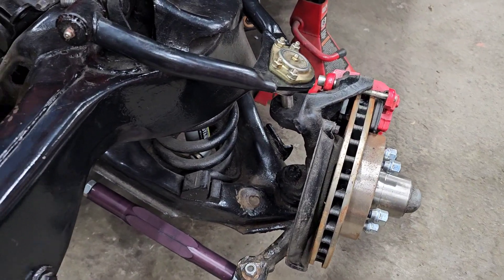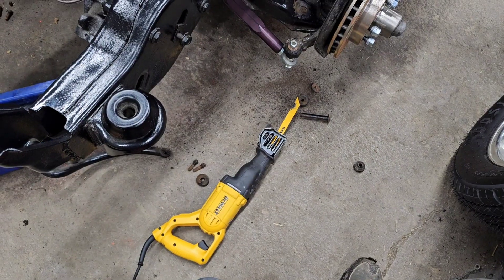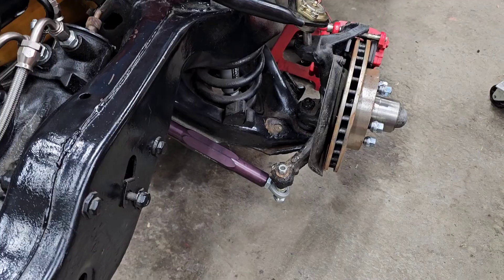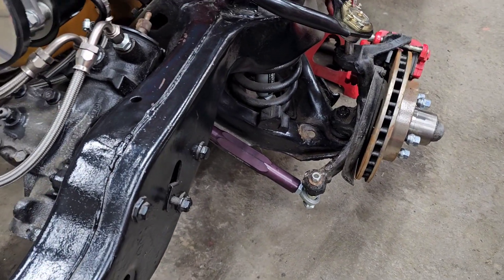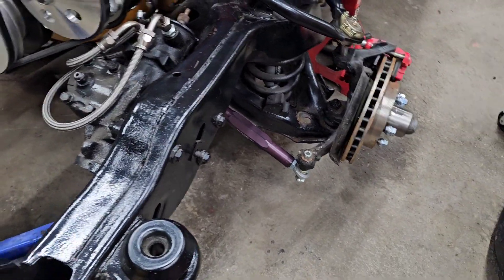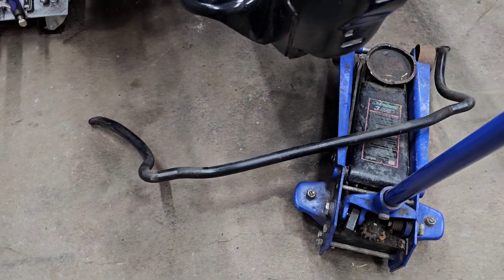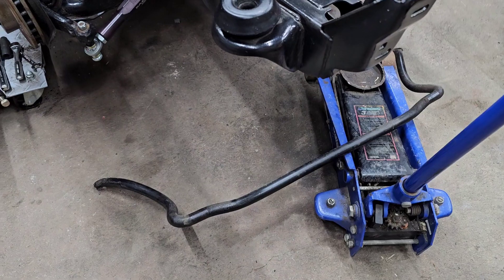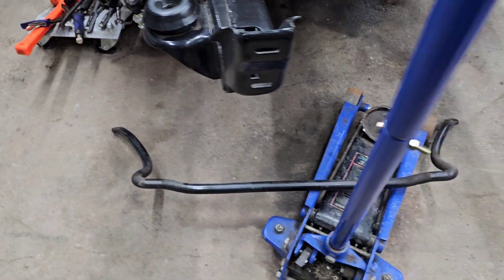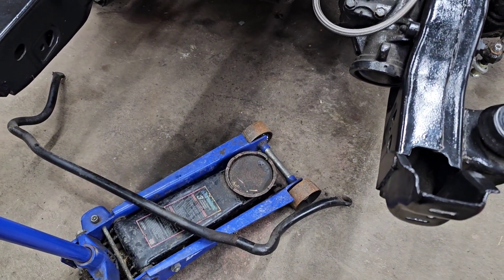I got this side out too, but don't let me fool you. I actually had to get the sawzall out and cut some of this off because I snapped the top off taking it out from the bottom like I suggested. I think these were way too far rusted. But it's out now, both sides. I cleaned up the area a little bit. Now I'm going to grab the sway bar, put the bushings on, and put it up so we can figure out how much modification we need to do to our end links.